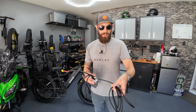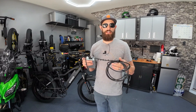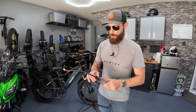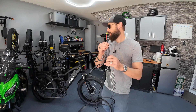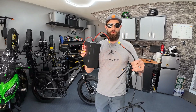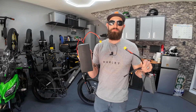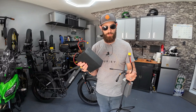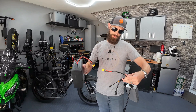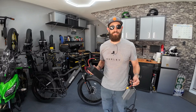The last wire coming off is the motor wire, which is eight feet long, so you can mount the controller anywhere on the bike and have plenty of slack to reach the front wheel. Another question that came up: what if you're mounting the controller in a different spot than the battery? The battery wire coming off the controller and the battery wire off the battery give you about 20 inches of wire. If you want to mount them farther apart, you'll need to create an extension cable with XT60 connectors on the ends. Everything uses XT60 connectors.